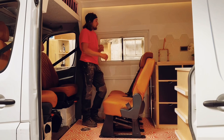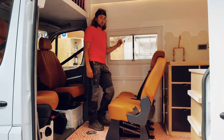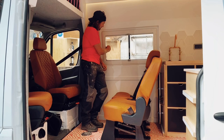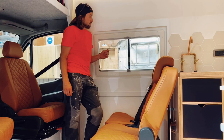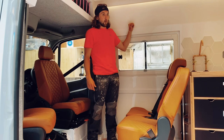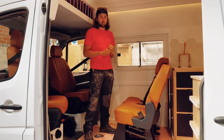The windows fitted in the van are the Dometic side windows — a decent window and I always recommend fitting these over the standard vehicle glass if your budget allows, just because they're a lot better for insulating purposes. They're nice and secure, they've got a little lock on the handle, slide to open, and we've also got a built-in blackout blind and fly screen. With that window and the insulation in the walls, ceiling and floor — medium density block on the walls and ceiling, and 25mm PIR board in the floor — it's pretty well insulated to keep it warm in winter and cool on hot summer days.